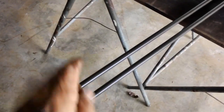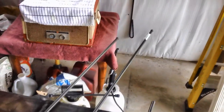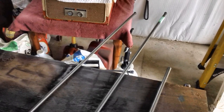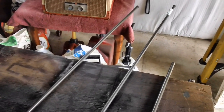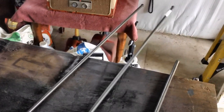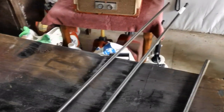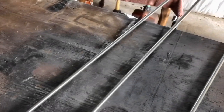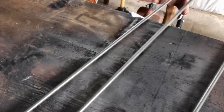We're going to be removing those because I'll be sticking this end into a hose on the gas line underneath the fender, and of course the other end goes into the hose, so I'll have to cut off the flare. And this one here, I'm thinking about using it for that windshield wiper motor line that I replaced with that 400 psi line. I replaced them all with 400 psi, but I may decide to go with a hard brake line type of thing.